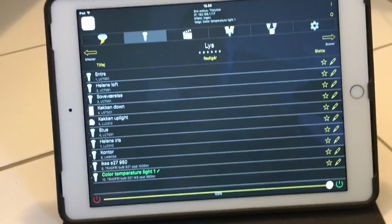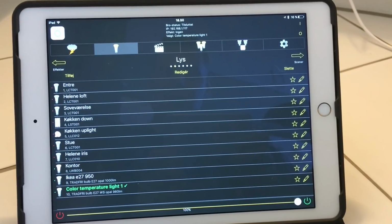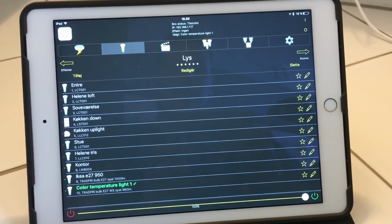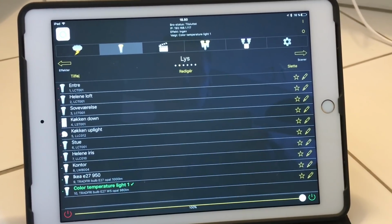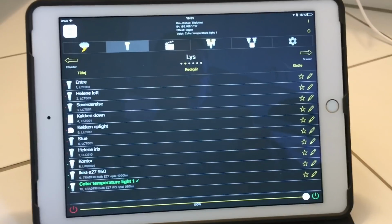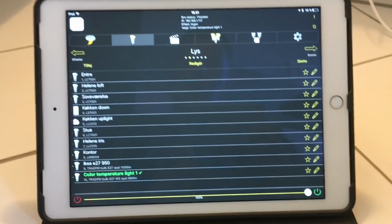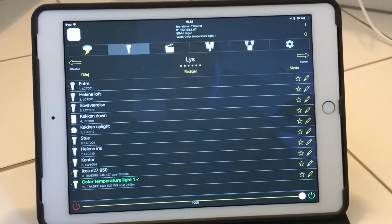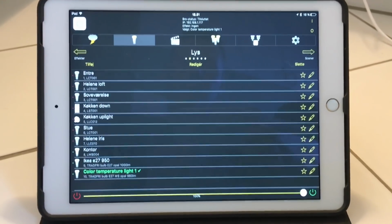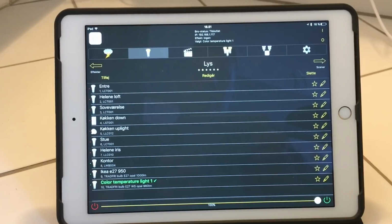So it did not work initially, so I just had to go through what I did the first time that made it work. So what I did was I switched off all of my existing Hue lights, which is not easy if you have light strips and stuff like that that's not necessarily turned on, but they are powered on. So again, I removed all power even from devices that were not lighting, but did have power. So to remove all devices, I then repeated the steps